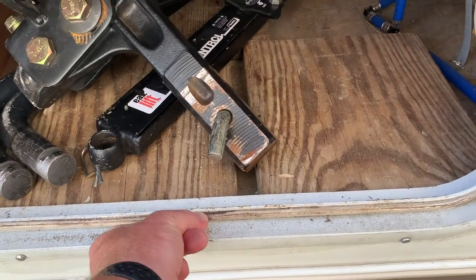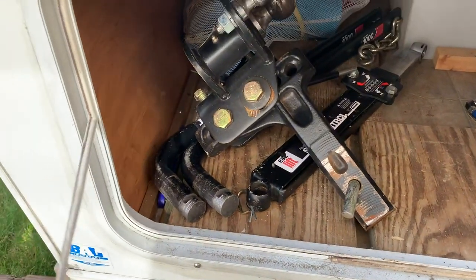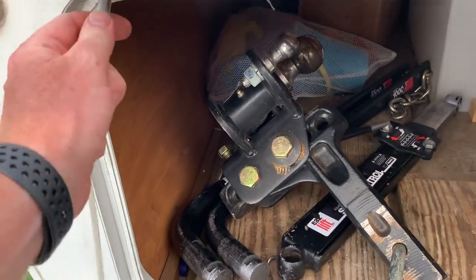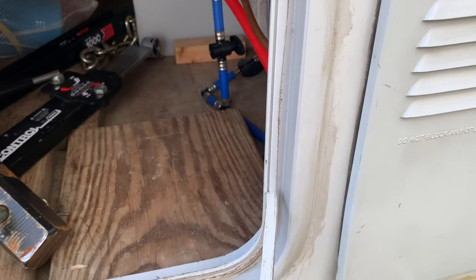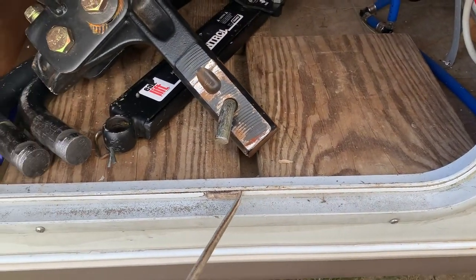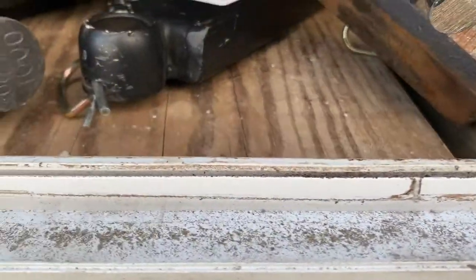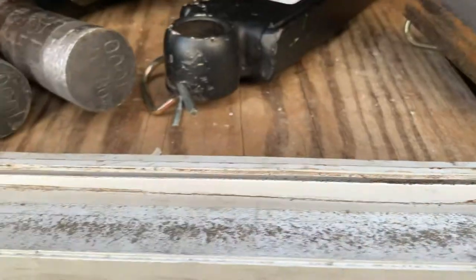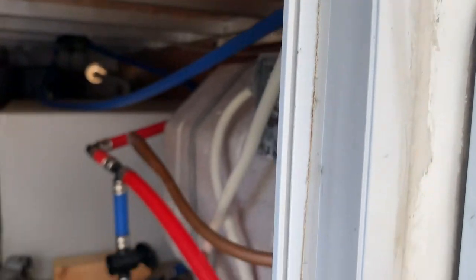So first thing you're going to do, just pull it off. Usually it's cut somewhere, so you're just going to pull this stuff off. Pull all the way across there, all the way down to the bottom. And that luckily came off as one piece. Now, if we look closely, usually this leaves its adhesive layer behind. It didn't on this one. Little adhesive up here in the corner, but usually it leaves its tape behind. So if there's any tape up there, you've got to remove the old adhesive tape. It's a double-sided clear tape, but I don't see any on here.